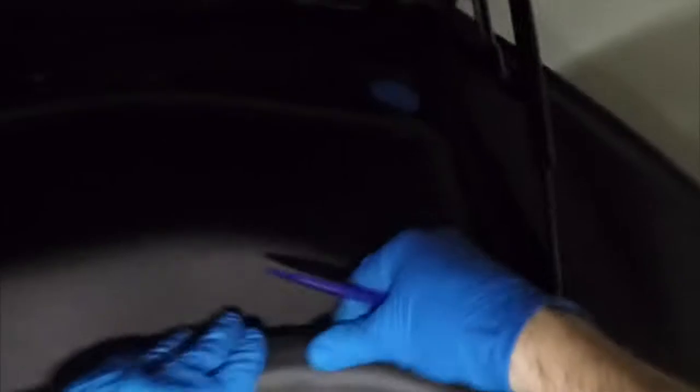So the rubber grommet, what it does is it clips to the hard plastic that's underneath the carpet, but you also need to ensure that your carpet's lifted up enough so there's a little gap that you can slide the carpet into that's between the rubber grommet and the plastic. So that's where the trim removal tool comes in handy. Close your hood and you're all done.